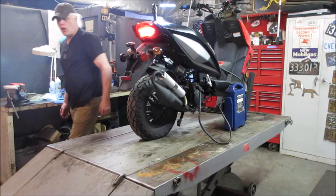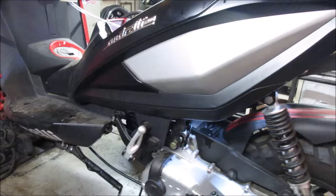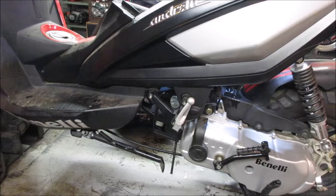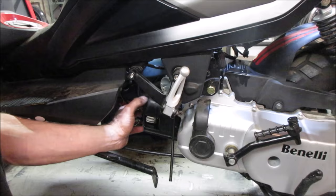Maybe that's what they thought it was. But something is happening where I think either we have crank seals, I'm just guessing, crank seals possibly that are leaking, and or just the top end is worn out and there's no compression. So let's go pop the plug out real quick, put our finger over the hole and give her a crank and see how it feels. Rightfully, she kind of pushed my finger off when I go to crank it. She doesn't feel too bad.